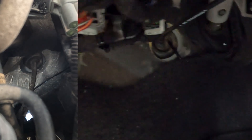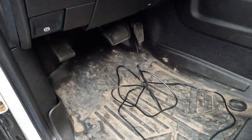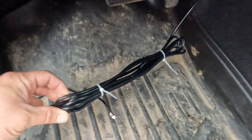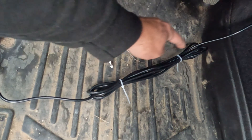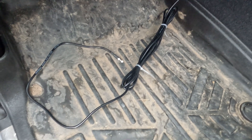We have now pulled the cable through the emergency brake grommet. Now we have just a bunch of coiled up cable — so what now? I'm going to pass the cable behind the pedals and then coil this up in a loose coil, lightly cinch it in the middle. With the excess coax cable, I've put it in a nice loose loop and did two cinches on each side. The idea is that the cable isn't tightly coiled, but you have this nice long loop so you don't create any standing wave issues.